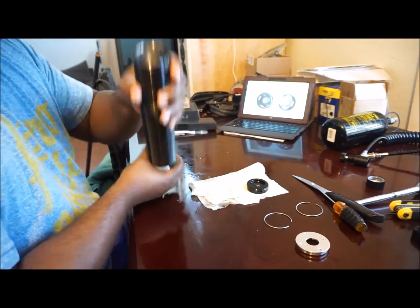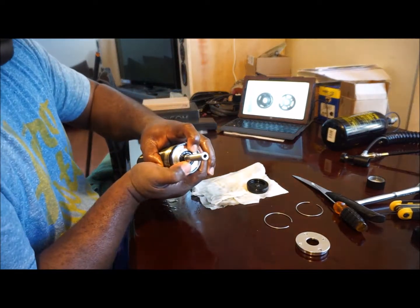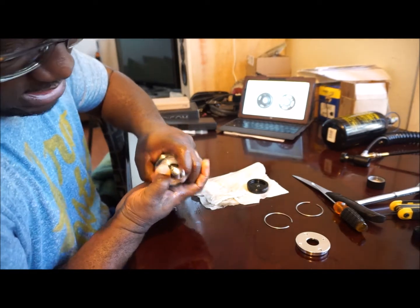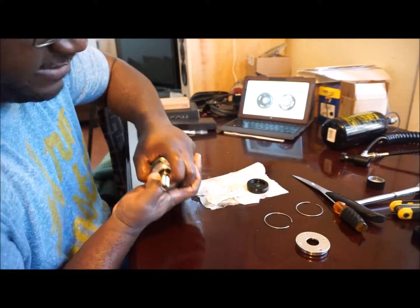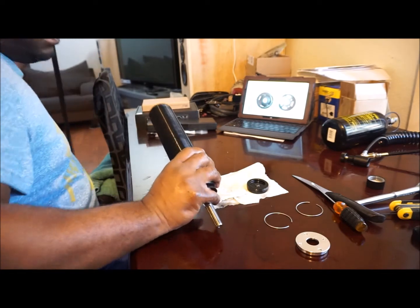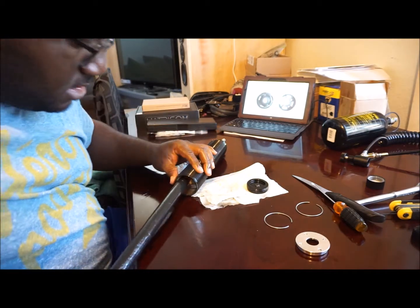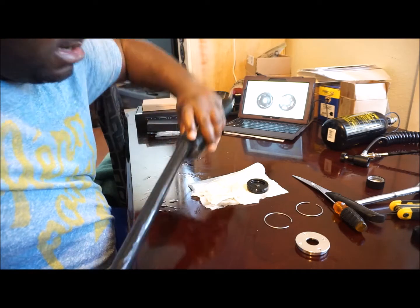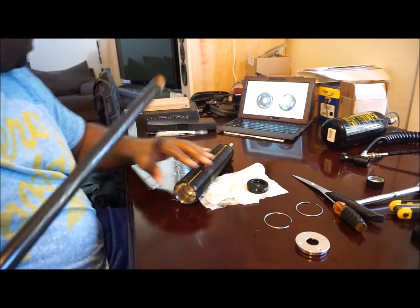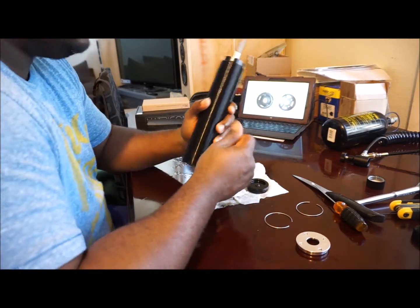You can see we've got it in there and the shaft is pushing out the dividing piston. I'm pushing down here and I want to get this wiper seal portion right below where the C-ring fits in the body — that's close enough. Now what I'm going to do is take this broomstick and measure off the distance there. I've already put a notch in it right here, indicating that is the maximum height I'd want the sliding piston to ever go, because it's close enough to the shock shaft.